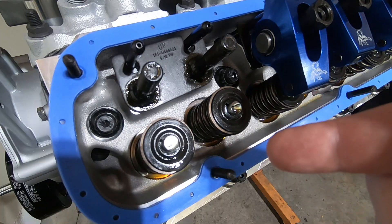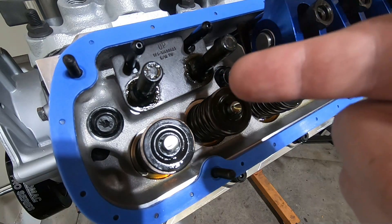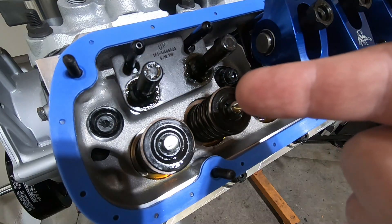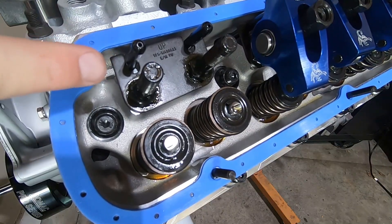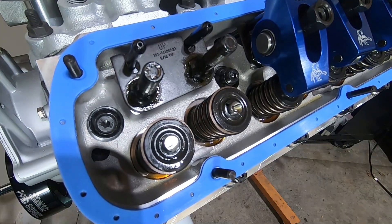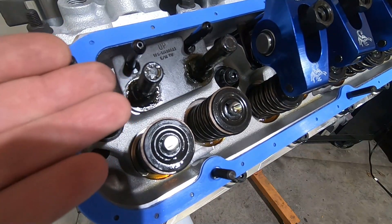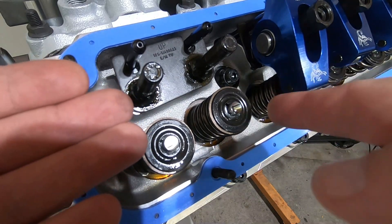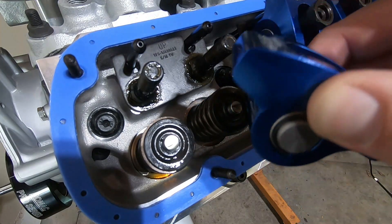There's really just one method to do this. I'm going to turn the crank over by hand and we're going to watch these pushrods and see what they do, and depending on what they do is the sequence in which I adjust these rockers. Right now my exhaust valve is starting to open — so the proper sequence is: when your exhaust valve on any given cylinder begins to open, stop turning the engine over and adjust your intake valve. That's what we're going to do now.